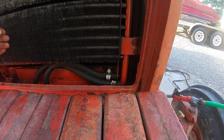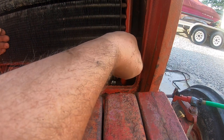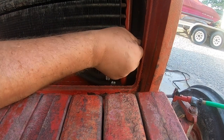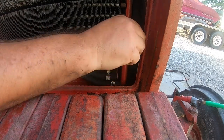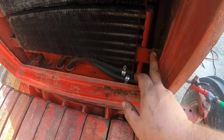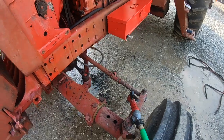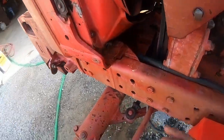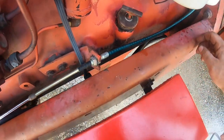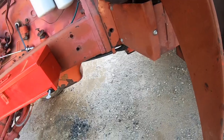This is simply a washer, and I call these a wing nut. We're going to start this up and check for leaks, hoping there are none. Got everything tightened back up, got the wing nuts on, got this flipped around and in place. Just looking over, making sure everything's lined up and out of the belt's way — don't want that rubbing the belt. It's up in the grooves. I just double-checked the tightness down here, so we're going to crawl in the cab and start it up.